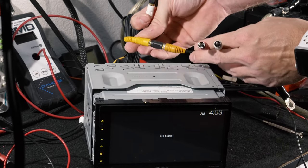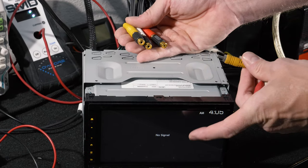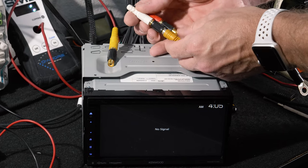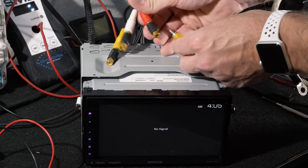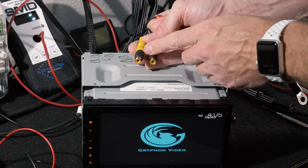You can see now we don't have video. The way we test this is by plugging it into one of the two other RCAs and seeing which one supplies video. We still have no signal — and now we have signal on the red. That means that these two are now audio.